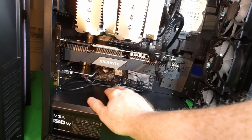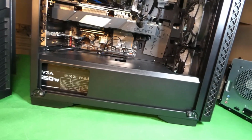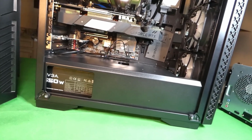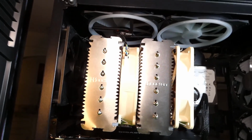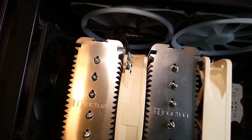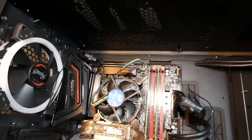I don't really like this huge opening back here that I can see. And then the fact that the ATX board, so that's a full ATX board, is basically sitting on top of the shroud. It'd be nice if this case was about 1 inch taller, I think. Now, nice things though, your CPU power connector, you can see it is routed up over the motherboard and around the right hand side of this. Same thing here. This guy is able to be routed up and around.